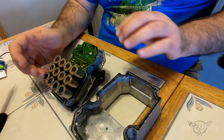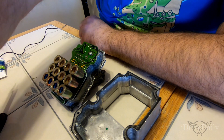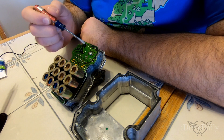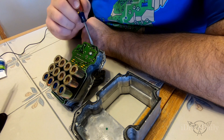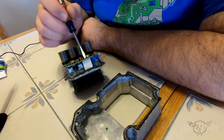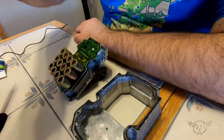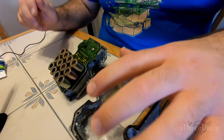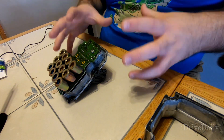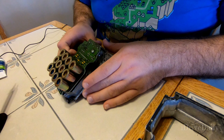So this is the likely problem with the C12-14 code my car is throwing. There are five solder points you really want to check — 1, 2, 3, 4, 5 — and you can see these three are connected to a switch down below. These are the solder points you want to re-solder to make sure the connections are good. I am not an expert solderer and I'm certainly not going to tell you how to solder, but I'm going to give them a shot myself, and then we'll essentially put this in the car without sealing the case first to make sure it works.